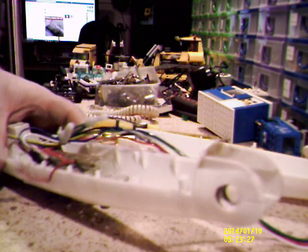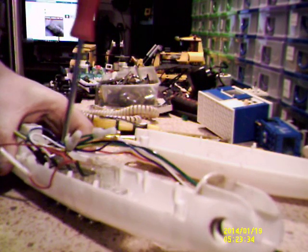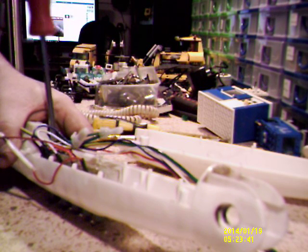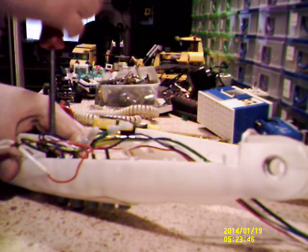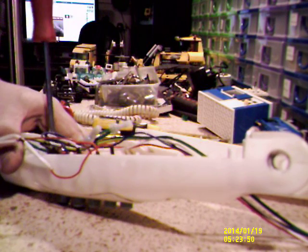Here we go. Ooh. Some interesting bits and bobs in here. May have to take this out all in one piece if I can. Get rid of some oily where the oil has ran down. Oh, there's neon in this as well. You don't see them a lot these days. I'll have that neon out of there because I've actually got a use for it. Should have a resistor in circuit. Right. I'll get screwed out of that later. Okay. So. I'm going to take the flex grip off.